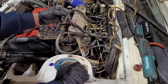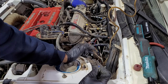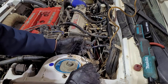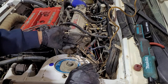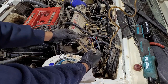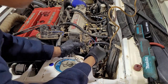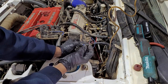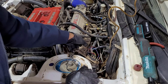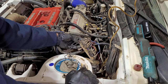With any sort of wiring you should keep your wiring as short as possible. Adding these coils in here looks pretty, however that's just adding resistance to the line. Electricity through wire is kind of like water through a pipe — the smoother and shorter the path you give it, the more pressure you give it. These are all crimp terminal connections here. It's not ideal to use crimp terminals; if you do use a crimp terminal you should solder them for this sort of application. This is the kind of thing that can put you out of a rally or create a misfire that you can spend hours chasing up.